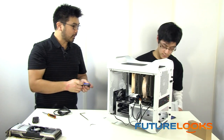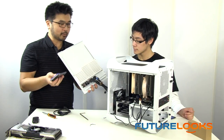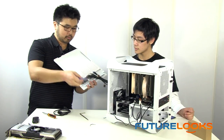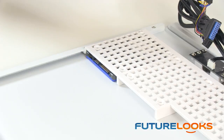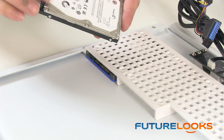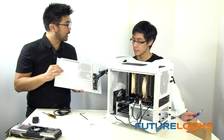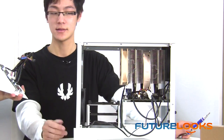I really like the way this door works. I like the fact that you have the option to store SSDs on the backside — pretty much unreachable. If you remove the thumb screws and bolt them on for security, you can actually mount two drives back here. You can have your storage drive and your main drive with SATA — and it looks like they're not even there. Even if you only have one SSD, you can mount another 2.5-inch drive that's much bigger for both storage and speed. For example, the Seagate Momentus gives you 750GB of storage.